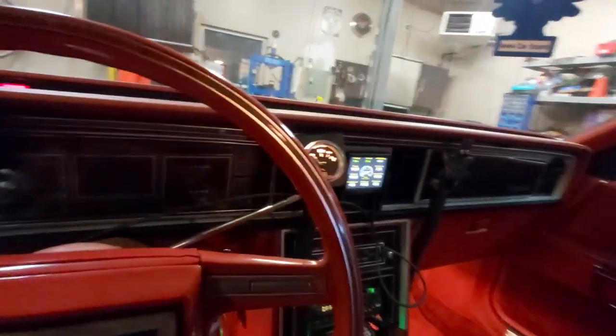So let's take it outside now so we can hear what it sounds like. Pretty good rumble there — actually pretty loud. This is a 408 cubic inch, 9.3 to 1 static compression boosted engine. I've got the Sloppy Stage 2 cam in there — that's 228 to 230 degrees duration intake and exhaust, and 585 lift both intake and exhaust. Pretty good tone, it sounds good.